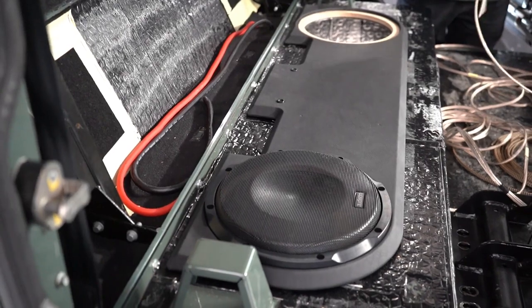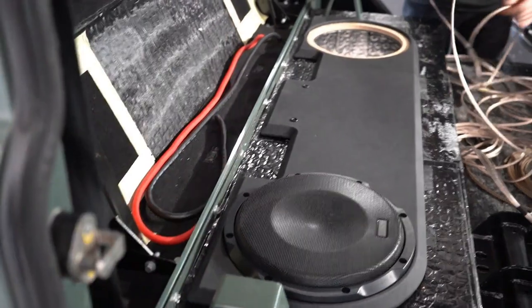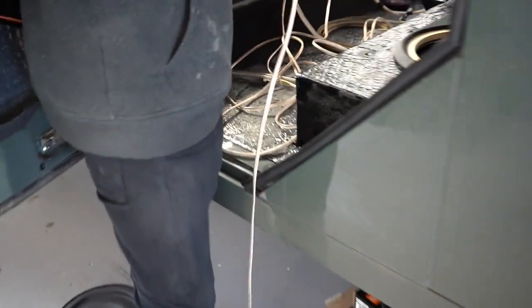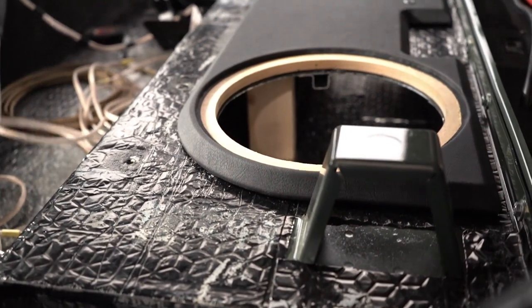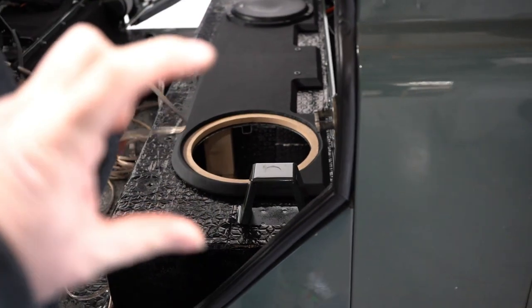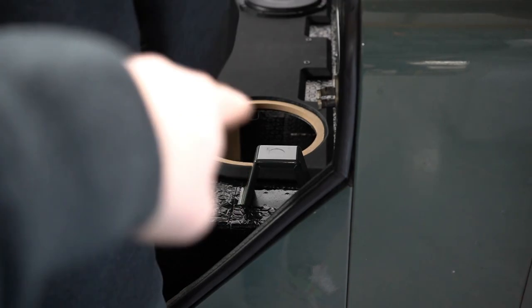As you can see, we're a couple of days further in. Subwoofer top plate is in. The underseat box is modified. It's been braced and deadened. In fact, let me take you around the other side quick. Just check out the bracing inside the box there. You can just see it. So there's one there, one over there. Should keep these two metal sheets, the top sheet and the bottom sheet, from flexing together. Then that panel there will be bonded to the top panel, and that'll really help with resonance for that panel as well.